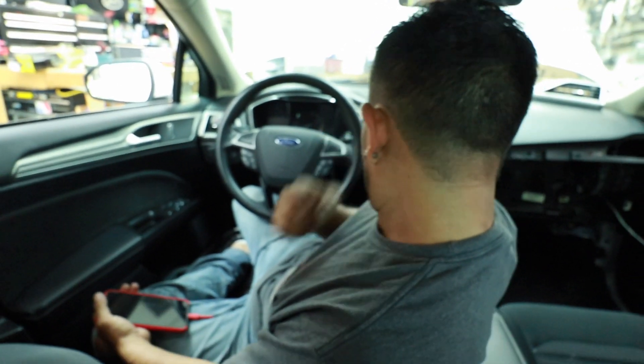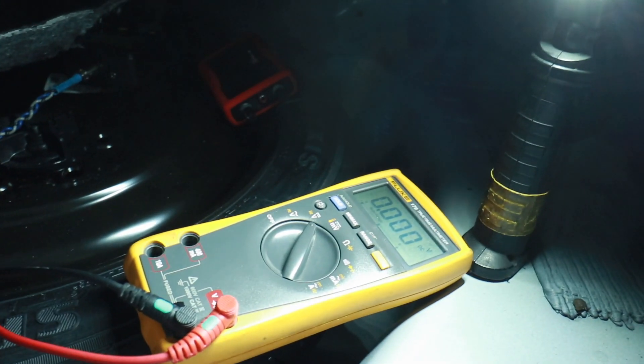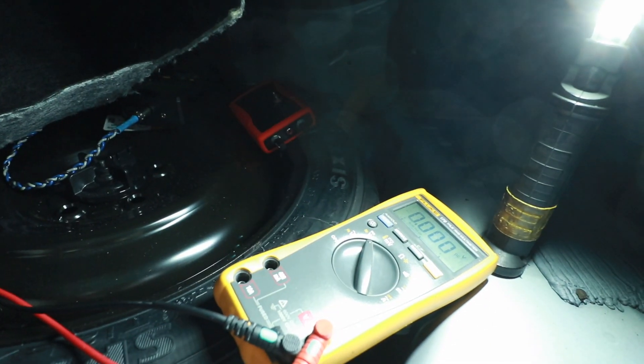Fernando has his watch going up front to see how long it's going to take. Keeping an eye on the voltage - it's off. That was about 60 seconds. When you arm it, we do one more test where we disarm it, exit the vehicle, enter the vehicle, and see how long it takes. It takes three minutes for this car to go to sleep and shut off the DC offset. This is normal. However, where a lot of people get scared on DC offset - meaning they don't think it's working - is when they disarm the car. The DC offset turned back on. That's perfectly normal.